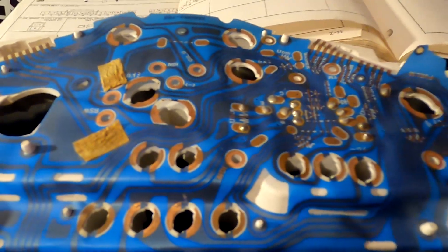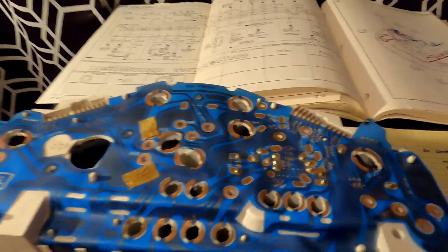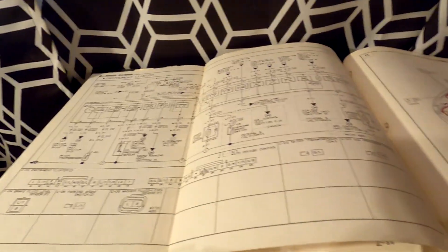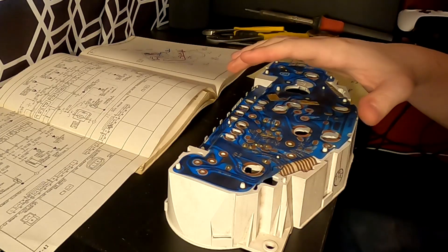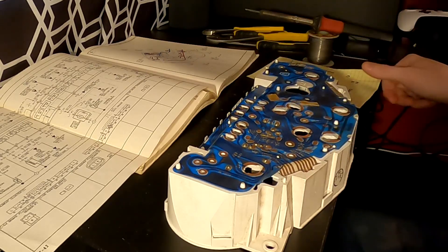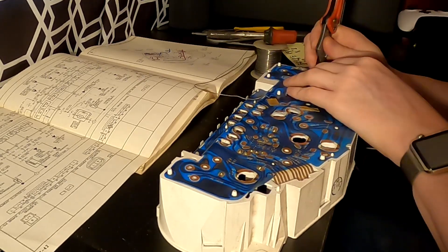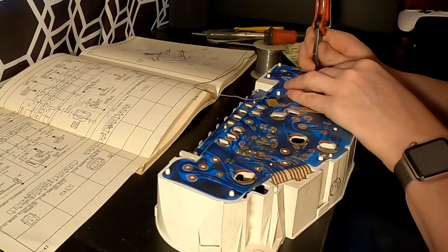I'm thinking I'll probably end up cutting out a large portion of the original harness so I'm just left with the harness connectors, because that's really all I need — none of the other wiring is going to be used here since most systems are going to be deleted or rerouted. If you're doing any sort of projects on your car, it's a good idea to have one of these service manuals. Next up, I'm going to start soldering to the traces on the flex board on the back of the cluster. I'll solder to the traces I have marked and extend wires off of them. In order to solder to these traces there's a thin layer of plastic over them — I just scrape that away to reveal the copper below.